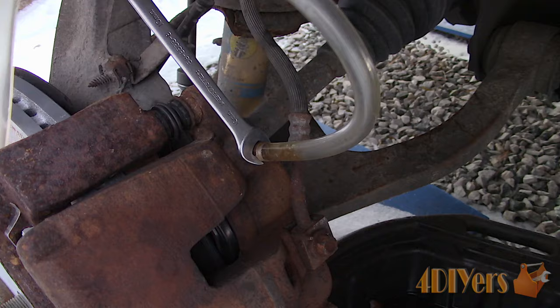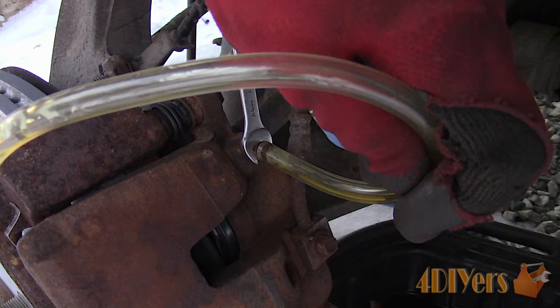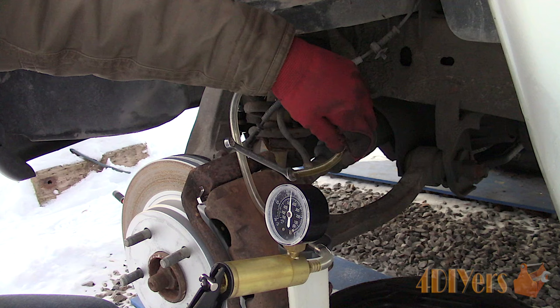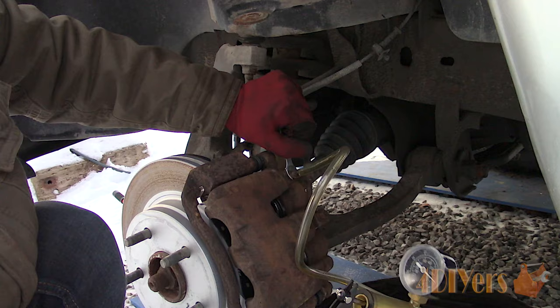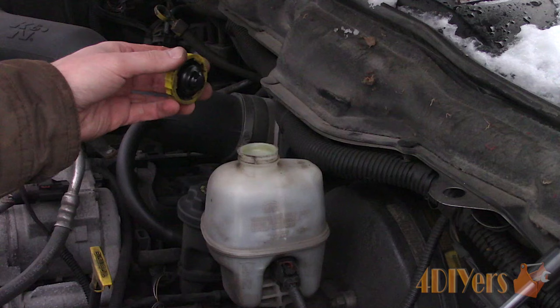I installed the wrench first, however the bleeder screw did need to be turned more in order for the fluid to come out, so I used the open end of the wrench instead as it was more convenient. Here's a closer look at the process for removing the line when done. As you can see the fluid is still discolored here so I will continue to remove more. The closest wheel to the master cylinder will have the least amount of fluid removed as it's the shortest run. Do not allow any brake fluid to come in contact with the braking surface. The pump can be cleaned using brake cleaner — just be careful around the gauge lens as not all models are resistant to chemicals.